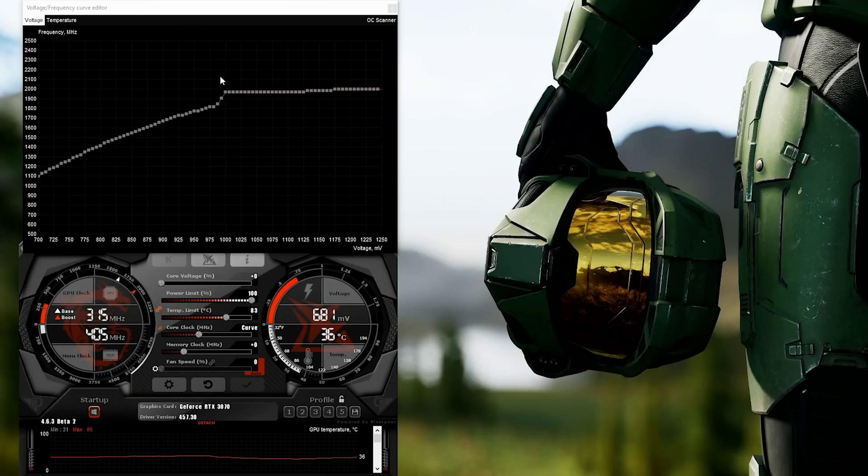What you'll notice is that the frequency will max out at around 1975 MHz and it should no longer draw more than 1.0V, which can reduce your power draw significantly. For me, I saw around a 50-watt drop and was actually able to get a little bit more performance — a pretty good trade-off. If you set a clock speed and maximum voltage and it's crashing, just like with overclocking, your clock speed is too high and you need to drop it. For example, if 1965 MHz is too high, drop it to 1925 MHz and hit apply. Continue dropping until you find a stable point. Once done, hit the checkbox to apply it, make sure it's set on startup, and you're good to go.